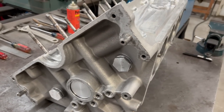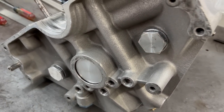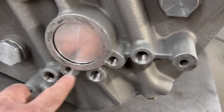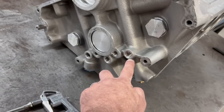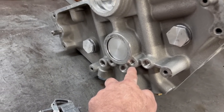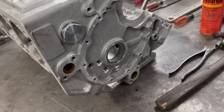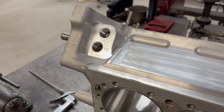We're trying to figure out the oil and stuff now. I called Brodix today — the snap ring they sent for the pan plug is not the right one. I had to order all these little fittings here. None of those were in stock. These are a different size — these are like dash-seven o-ring. I didn't even know they made a dash-seven o-ring, and these are, I think, dash-six o-ring. Up here these are going to be the restrictors.